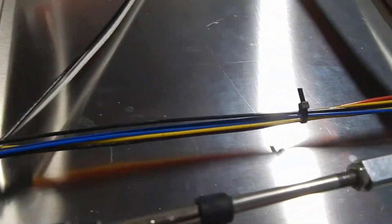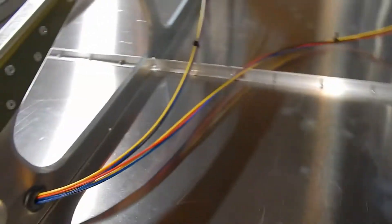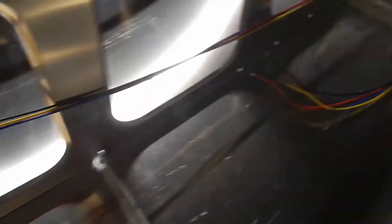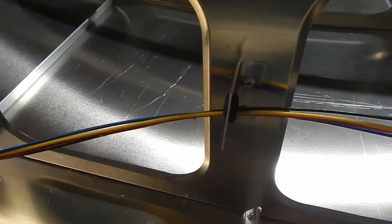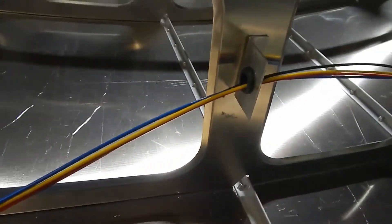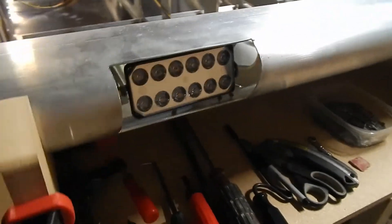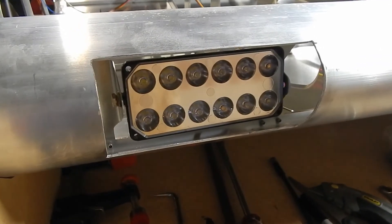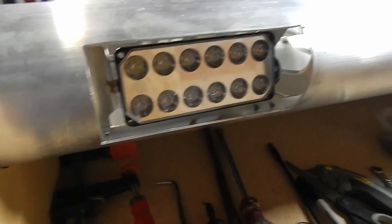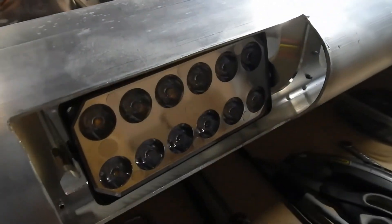I decided to zip tie and wire tie my wires going up through the ribs, wire tied all the way up. The set of wires going to my landing light — I wasn't sure what to do with those, so I fabricated a little angle bracket from aluminum, riveted it on, put a grommet in, and ran the wires through. I did rivet the landing light into place, tested it and it works fine. I set the angle in and down, assuming my attitude when taxiing and landing will be similar — I may have to adjust it later.